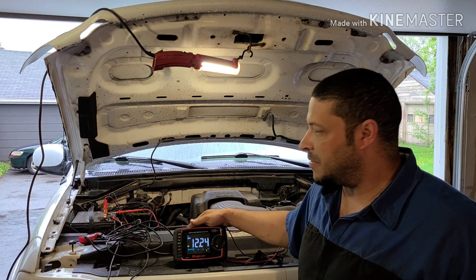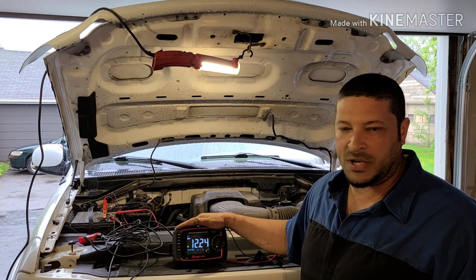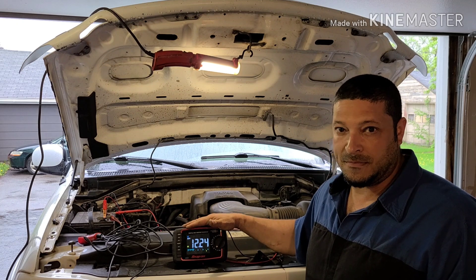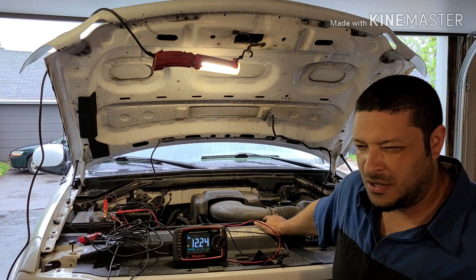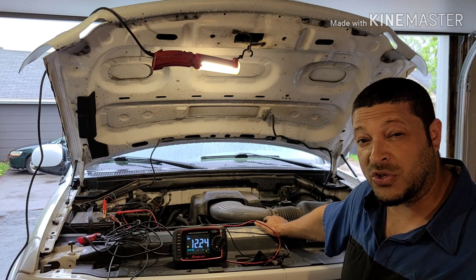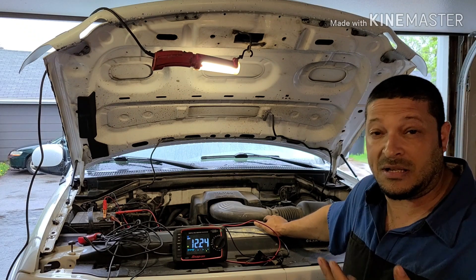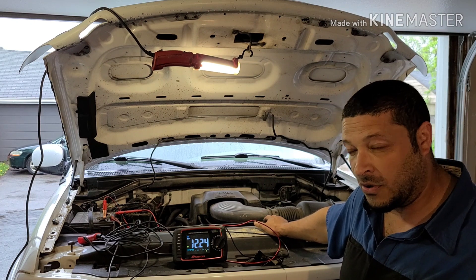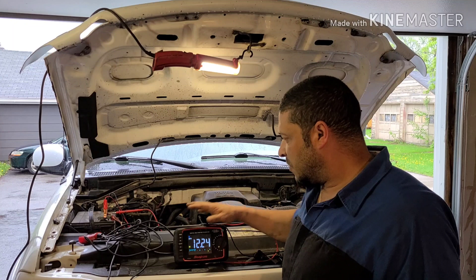For DVOMs, this is what's used pretty much on a daily basis in this shop — a dealership. You're going to ohm circuits and test voltage. This is going to be your accuracy guide. When it comes to running through your flow chart for service information, any dealership is going to want to know battery voltage, ohms, resistance, circuit end to end, continuity to ground, short to ground, short to voltage — things like that. That's pretty much where this baby comes in handy.